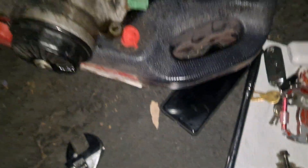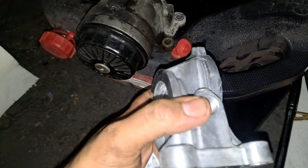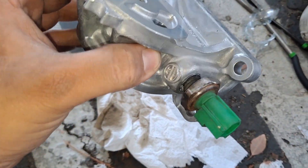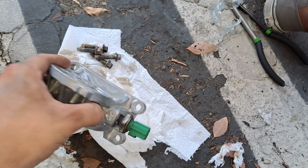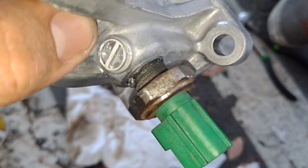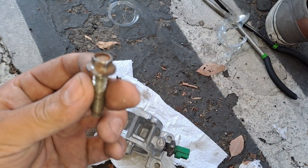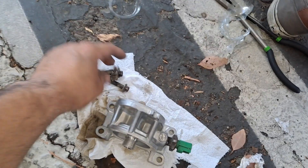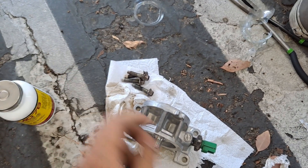This works off the car, so you can take this off. Here's the new one — that sensor is going to go right here in this port, and that one bolt for the oil cooler goes on top. I went ahead and cleaned it a little bit, put new Teflon tape, and put anti-seize on it as well.